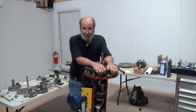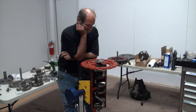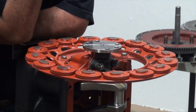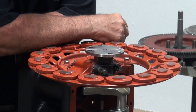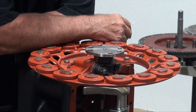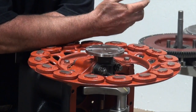We'll take the flywheel back off and I'm going to pull out about 30 thousandths. We had no gap — the flywheel wasn't even fully down. I know I pulled four thousandths out of one side to get it reasonably square, so I think I'm going to put it back together with no shim on one side and maybe four thousandths shims on the others. I started with about 30-some thousandths thick shims and pulled off four, getting me to about 26 each. No tighter than 25, no looser than 40 — we'll try that and see. We're into a little bit of trial and error.